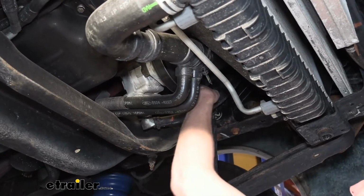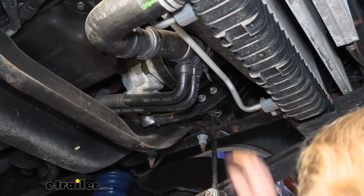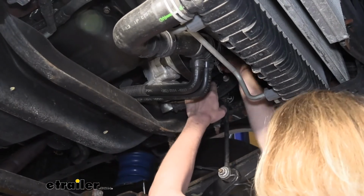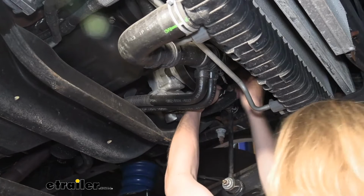So yeah, when that's the case, when they get stiff, you can just use your ratchet and thread it on out of there. Looks like we had to switch to our wrench here just because we were getting close to the pulley. We don't want to get our ratchet stuck, so we'll just switch to our wrench to get it the rest of the way out.